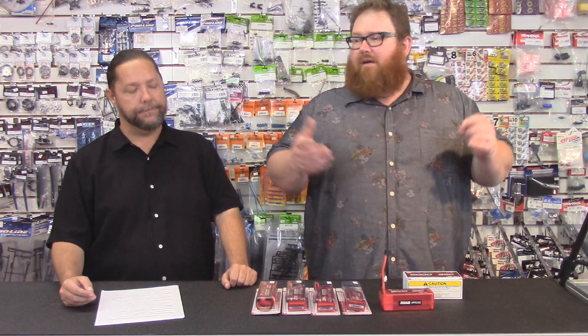A perfect example: for a brushless Stampede or brushless Slash, Traxxas recommends 25C minimum. If you run a 35C or 40C battery, you're going to see a noticeable improvement — probably worth the difference in price from a 25C. But if you start running 80C and 90C batteries and paying $30–$40 more per battery, it's not worth it. You're not really going to notice much difference between, say, a 30C and a 60C once you're that far above the minimum.